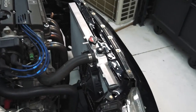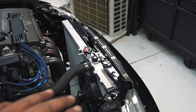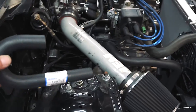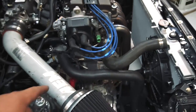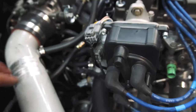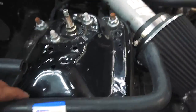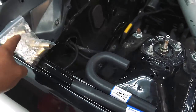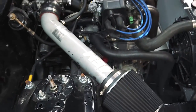The radiator is in and hoses are hooked up. I'm going to go ahead and build this bypass hose real quick. I've got a 180-degree hose and a 90-degree hose, and basically I have to go from the cap right down here to the cap on the thermostat housing. I've got a union hose fitting in the middle and a couple of clamps, and it'll look something like that once it's done.